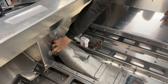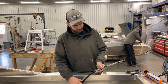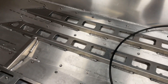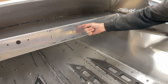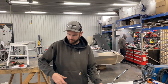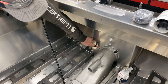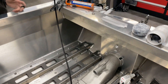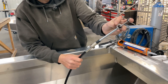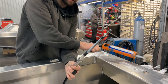We're going to do the steering cable as well, which goes in this hole. This cable is 12 feet long — this is an 11-foot boat, we just go a foot oversize, that's the typical installation length. The cable runs under beside the engine, then comes up in a high loop past the floorboard and kick plate area and into the steering helm. There's a starter hole in the adapter plate that is slightly undersized — when you drill it, it will also align the hole in the transom perfectly. We go in with a 23/32 drill bit.